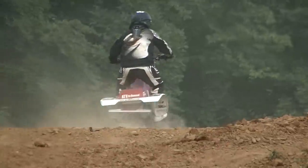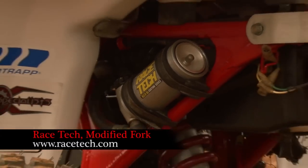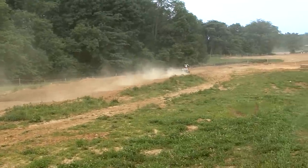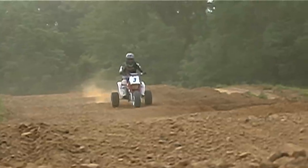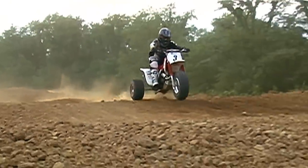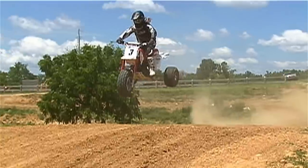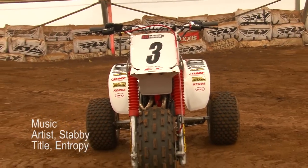We wanted to significantly improve the 350X suspension while keeping it truly vintage, so we turned to the vintage dirt bike and ATV suspension experts at Racetech, specializing in custom applications. Racetech didn't back down from the challenge of setting up suspension for a machine that they'd never done before. They drilled out the fork's lower compression holes for unrestricted oil flow and installed their gold valve emulators. The emulators mimic the function of cartridge forks, separating out the compression and rebound circuits for individual tunability. The emulator valve controls compression damping, using different springs and variable spring preload to control how much the valve opens under a given amount of oil pressure. Changes in rebound damping are achieved using different weight fork oil. To finish off the forks, Racetech switched out the stock springs for stiffer 0.52kg springs.